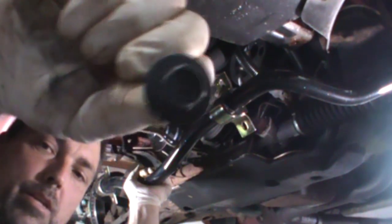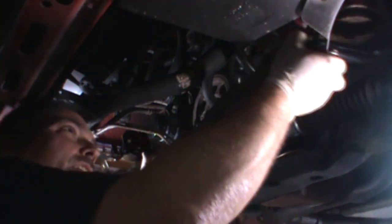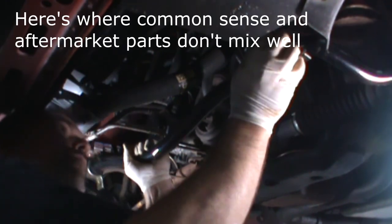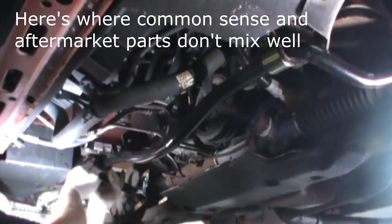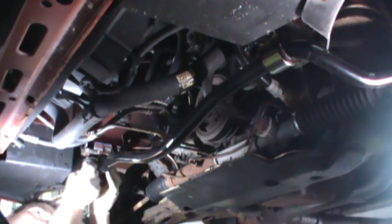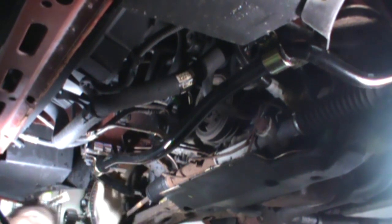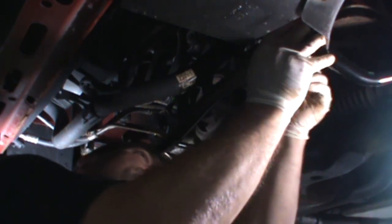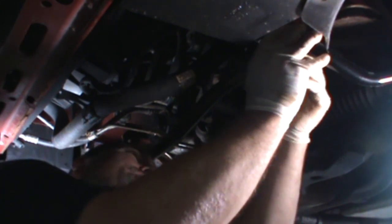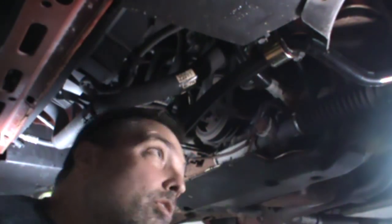And I found some really cool bolts that I had in stock with the washers on them. Nice, right? Cool when you save some stuff. I got these bolts, I believe, from a strut or something like that. Always cool to save them. Got the washers built onto them. Usually a nice grade 8 bolt, or the metric equivalent, before I get roasted. We're going to snug these up, but we're not going to tighten them until we get the links in.